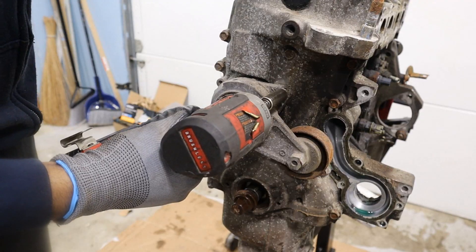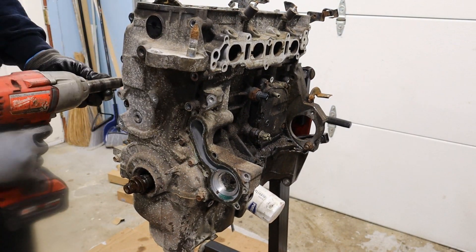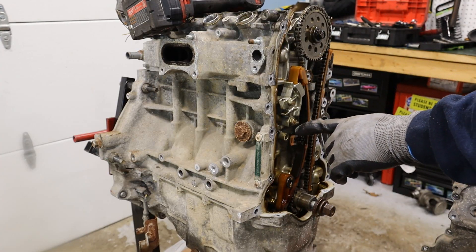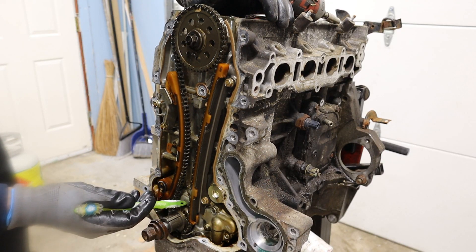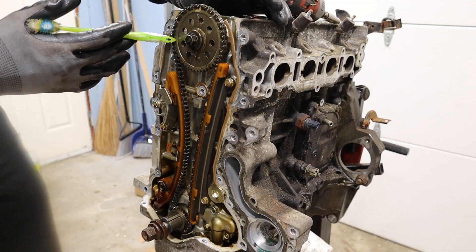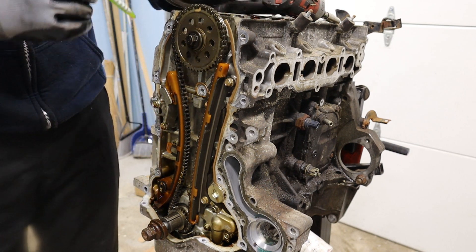Now I'm going to take off the tensioner with a 12mm socket, then remove all the bolts for the front timing cover. Notice this doesn't have an inspection port for the tensioner. Being a Honda, it's a very simple engine design. The oil pump at the bottom is direct drive — no chains going to it. There's only a single chain that goes from the crankshaft up to the camshaft, no variable valve timing, just one to one. The tensioner appears to use a leaf spring design with plastic slides on both sides.